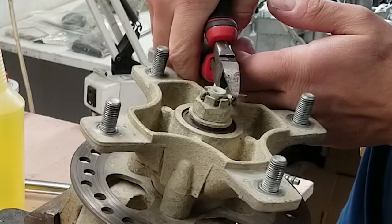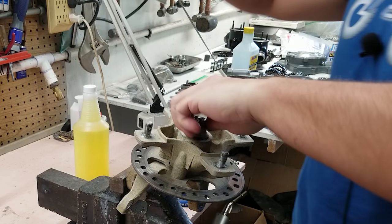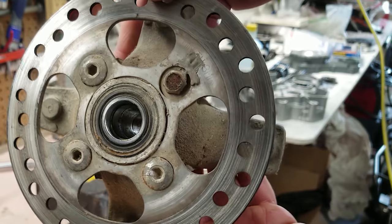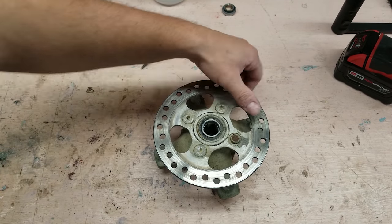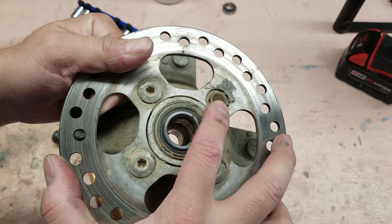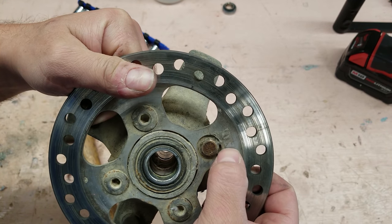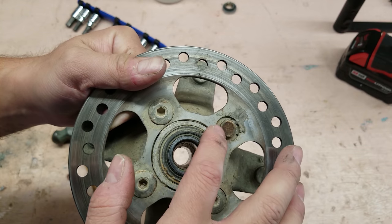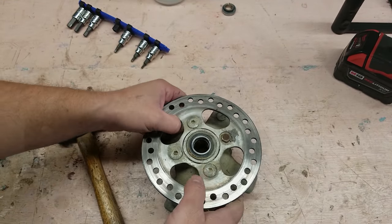Let's see if we can get this hub nut off and get this cotter pin out - I hate cotter pins. Not too bad, and the grease in here actually looks pretty good. I wouldn't be surprised if these bearings were somewhat recently replaced because they're nice and tight. Now this genuinely scares me - there's a custom bolt going on back here. You can see all the cracks in this rotor too. What really scares me is that this feels like JB Weld, and I'm really hoping this is not a stripped bolt that somebody put JB Weld in the hole and stuffed a quarter-20 bolt in there.